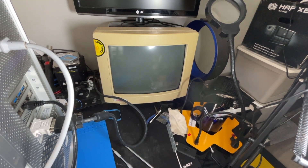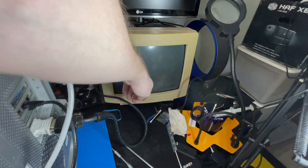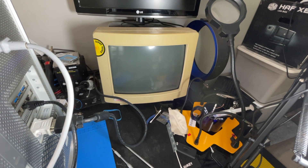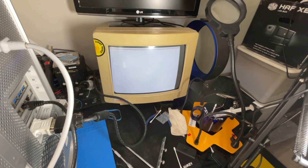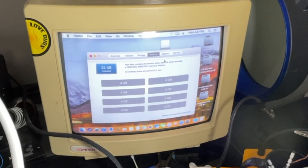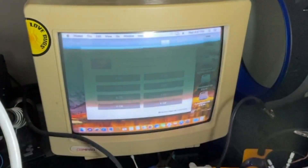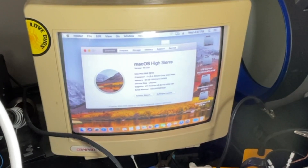Let's see if there's magic. It's making noise — let me put my monitor on. We're listening for the startup chime — yay, big dong! We got the memory kerfuffle solved: all 32 gigs have been detected. I think it might have just been the CPU needing a little bit of pressure put onto it. When we replace the CPUs with the best ones everything will be good. For now we've got two 2.4 GHz six-core Intel Xeons and 32 gigs of DDR3.